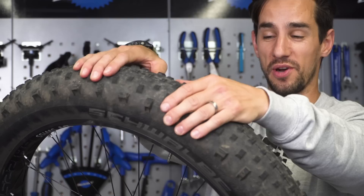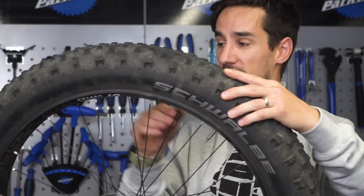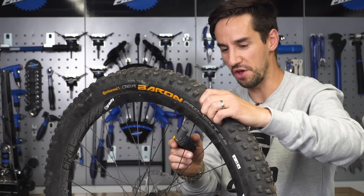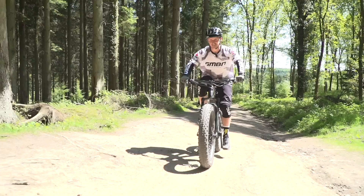It's nine PSI — that's surprising. Nine PSI is surprising, but it feels much harder than that. You can't actually push it in that much; it's just such a huge volume tire. This is only a four inch tire, so it's pretty much the limit on the smaller side of fat bike tires — they can go up to five inch tires. Now the plus size tire is definitely more than nine PSI. I'm going to guess 22. Nineteen. That's not too bad — still fairly soft though, to be fair for Blake, especially he's a big clumsy bike rider.